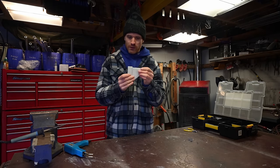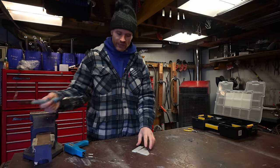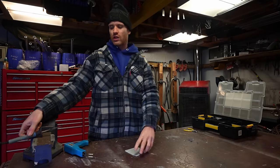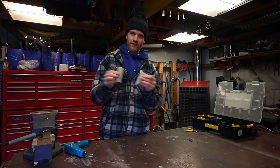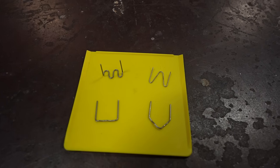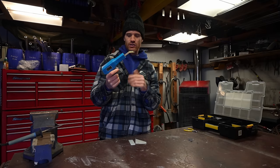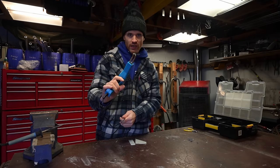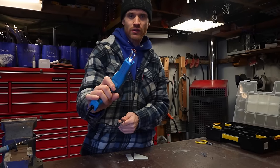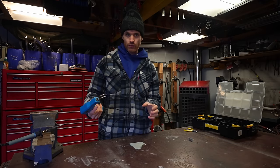Basically, if you've ever got two bits of broken plastic — like a fairing or a wheel arch — what you'd normally do is use a soldering iron to melt them together, which sort of does the job but it doesn't last very long and doesn't stay very strong. With this gun you get these tiny little metal clips — loads of different styles come with the kit. The gun doesn't need time to heat up: you just plug it in, press the trigger, and watch how quick it heats up. It creates a short circuit which gets that little clip red hot, and then you press it into the plastic and it melts in, creating a really secure join.